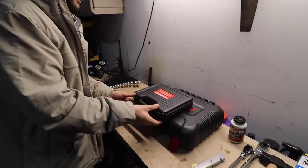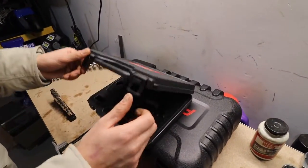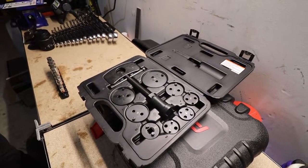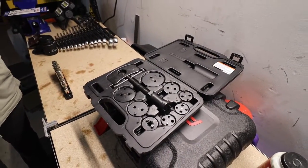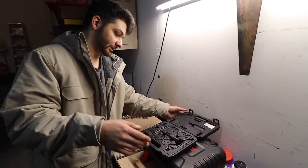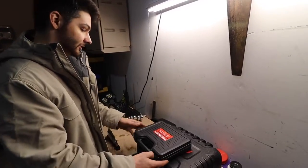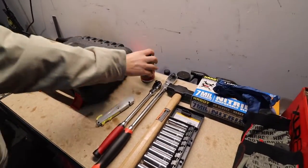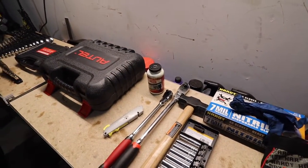Also, we got this from Harbor Freight. This is pretty much your piston retractor kit, because once your brakes are under pressure and everything, they push in, so you have to push that caliper back. I won't get into too many technical terms. I don't want to confuse you guys. But yeah, and then we got some ratchets, some brake grease, some gloves, pretty much all you need,